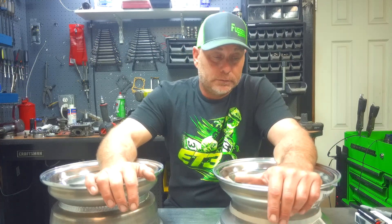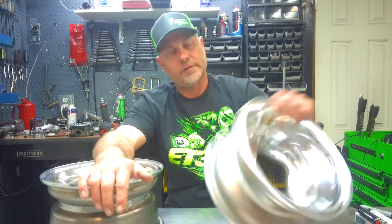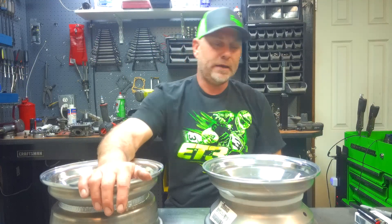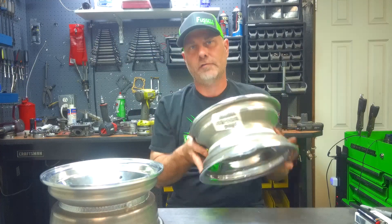If you do need wheels, check out gotbuggies.com. We sell ITP wheels, steel and aluminum, and we're actually looking to pick up a whole other line of wheels. If you're shopping elsewhere or buying a used wheel and want to take a tape measure out to figure out what works for you — all you've got to do is flip the wheel backside over, take a tape measure, eyeball the lip, especially if you know it's a 10 by 5, then check the other side and you can figure out your own offset right there.